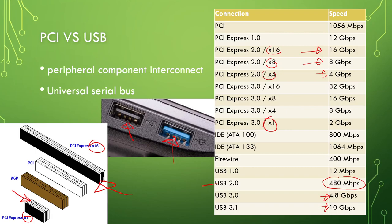You can do things like load-share Ethernet cables. If a server's 1 gig connection isn't enough, put a second Ethernet controller in and run two cables to your switch — set it up to load-share, sending half the data down each, effectively doubling your network speed. Or you can do failover — if one cable fails, traffic goes out the other so your server never goes offline.